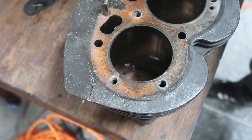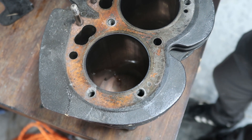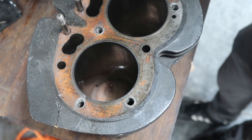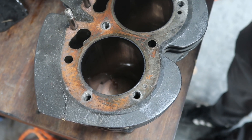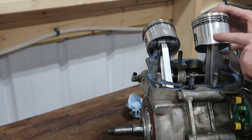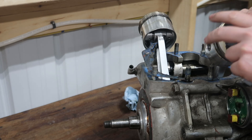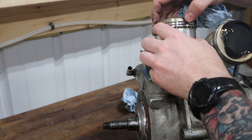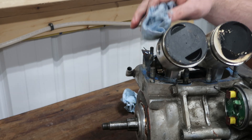I am going to take my cylinder head to a machinist friend of mine, Glenn Buley — he works on Vincents for a living. He's going to help me out with my cylinder head, new valves, and all that stuff. I'll have him look at these cylinders as well to get his opinion, as he is much more experienced than myself. Down on the bottom here where the skirt's hitting, I think that's where the wear is — same on this side, a little bit of wear on the skirt.